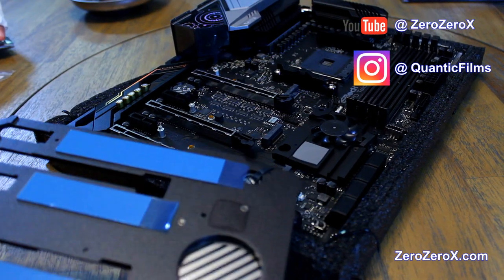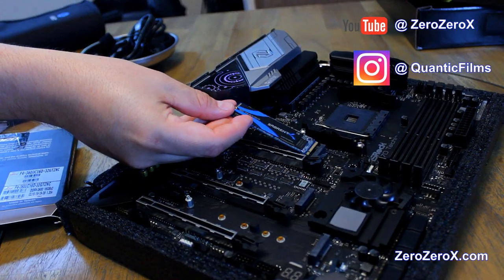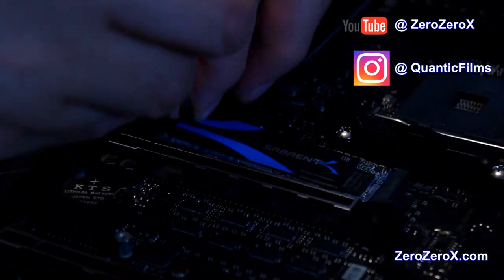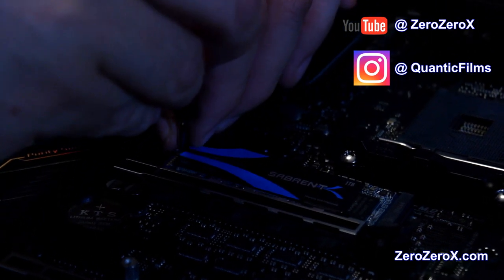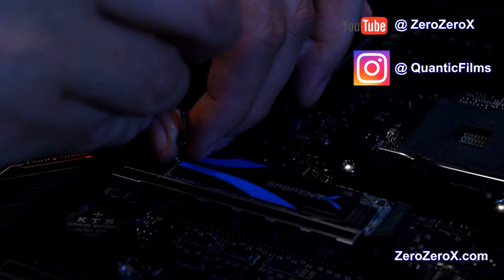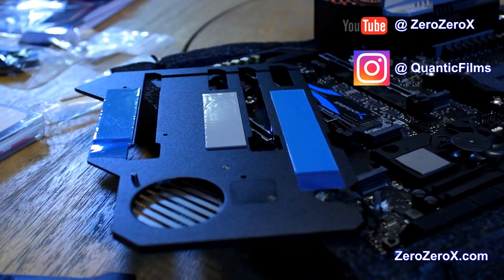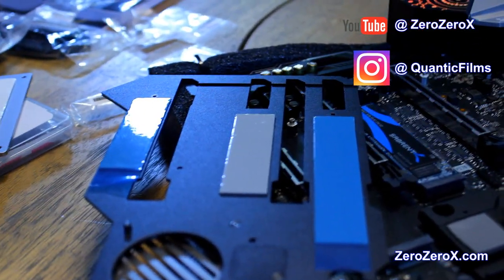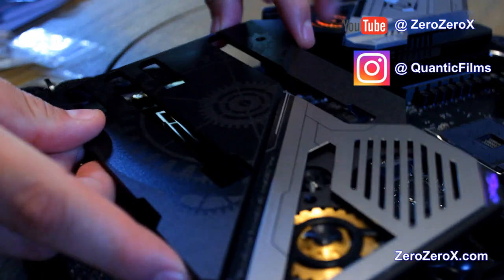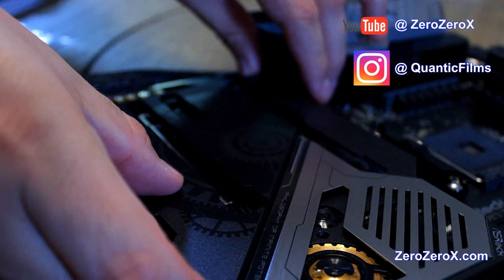We take out the thermal plate, and you can see the thermal paste. The thermal compound is covered with a protective layer. We're going to put the SSD — the M.2 drive — not on this slot because it interferes with the plate screws, but in the middle slot. Then we'll use the thermal compound on the plate to keep it cool. Although it's PCIe 3, it's good to maintain good temps on your storage. Under this plate is also a cooling fan for the motherboard itself.